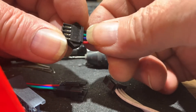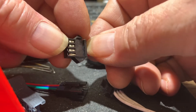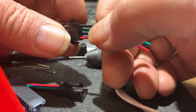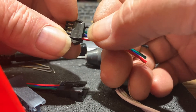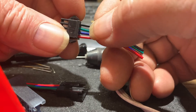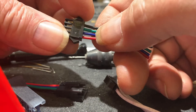Normally a JST has a straight latch, but this clone is slightly curved. It appears that the terminal is a little bit too large and drags inside the plastic. The edges are relatively sharp, possibly with metal flashing, which snags on the plastic when they come out.